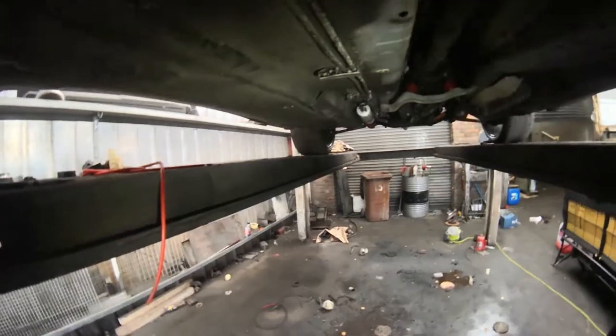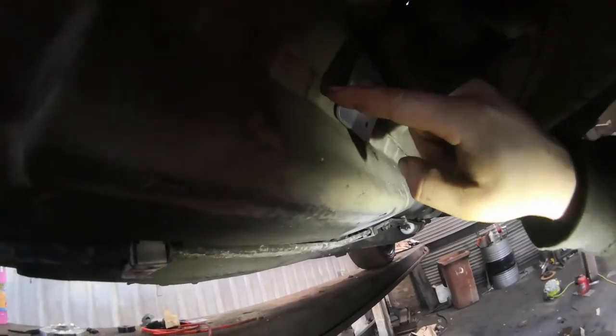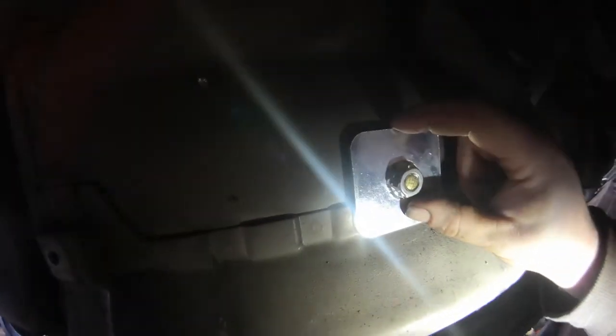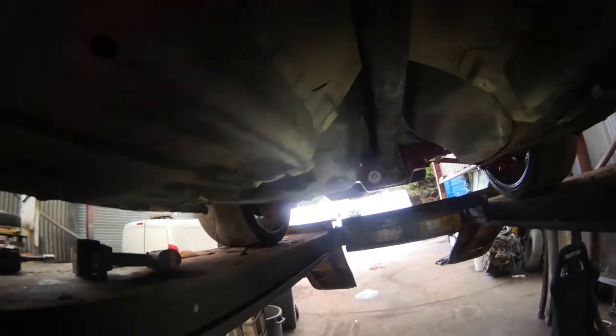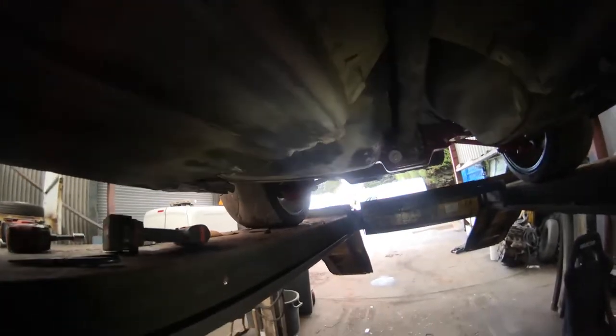Harness-wise, the inner two are basically going to sit in the transmission tunnel. You've got these spreader plates and I've tried to keep the spreader plate on as much of that lip as I can — it sits absolutely perfect on there. You don't need masses of weld around these, just enough to stop them moving, so I'll probably do a little line here, a little line there, and a bit at the top. Because I've got no mates, I hold it like that and just screw the spreader plate on.